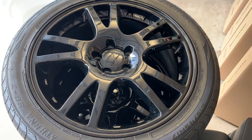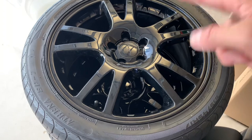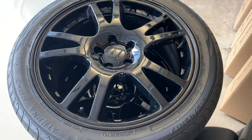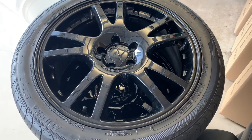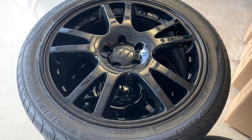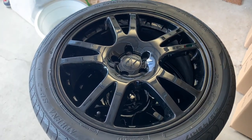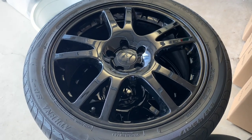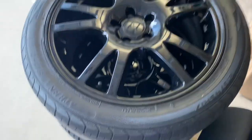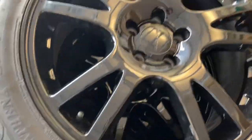We picked up some wheels - what I thought were Subaru STI wheels off a GD Rex STI. Turns out they're replicas. You can get fake STI wheels - they're seven inches wide, not seven and a half, and different offset: 45 offset, not 53. But they do clear Brembo, so we might use them on the project just to wheel the car around, maybe as a road wheel when we're not on track wheels. Be sure to check for fakes.